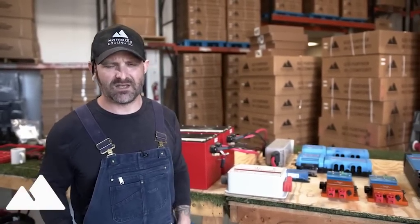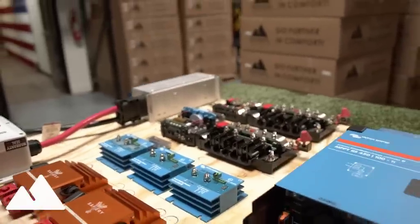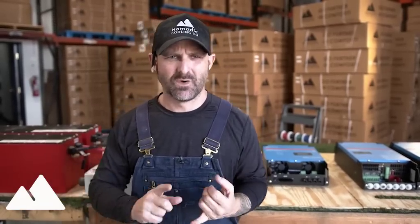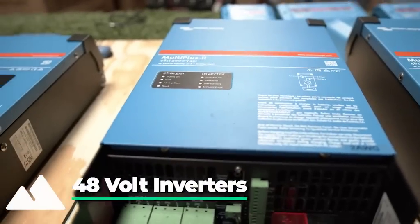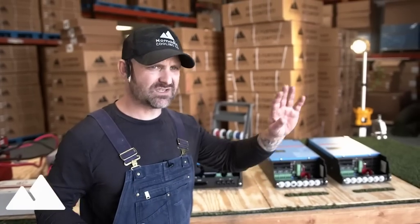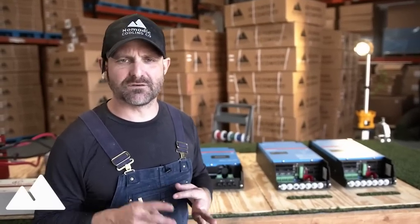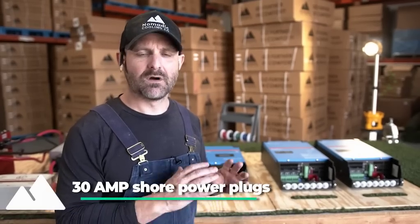Let's take a brief rundown of what's inside the F750 electrical system. Behind me, we have a very complicated electrical system — it's a completely separate 48-volt and 12-volt system. On the 48-volt side we have lithium batteries; on the 12-volt side we have Victron batteries, and they're completely separate. We have two 48-volt inverters — these are 3000-watt, 35-amp inverters. Two means that if something happens to one, we still have the redundancy. This gives us two independent shore power plugs and inputs from two generator sources — four different ways to charge the vehicle from the 110 system.